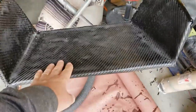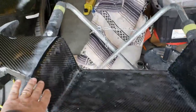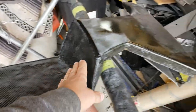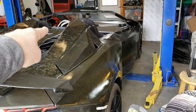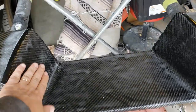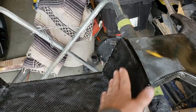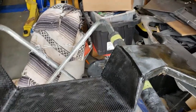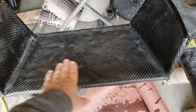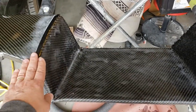Anyway, to the project — we have done the skinning. What we did here was we took the roof section out; this is the roof section that goes over there. One of the things I noticed is it was higher here than it was over here, so we fixed that and matched it to the engine cover. Then the slope of this side and the slope of this side were different, so I cut it all apart and re-sloped everything so that it has exactly the same slope. We also had to flatten this out — it was actually pretty bumpy. Then we skinned it in carbon fiber.